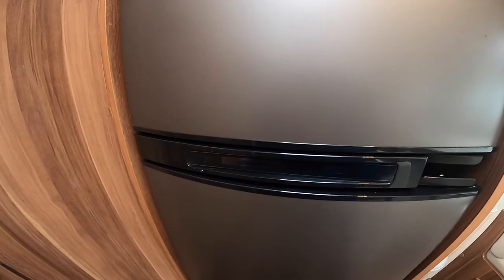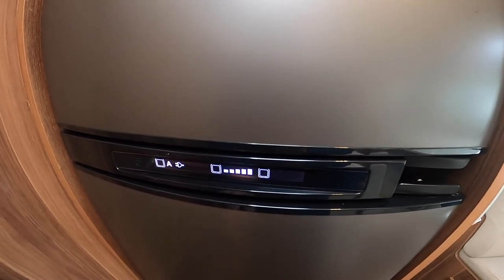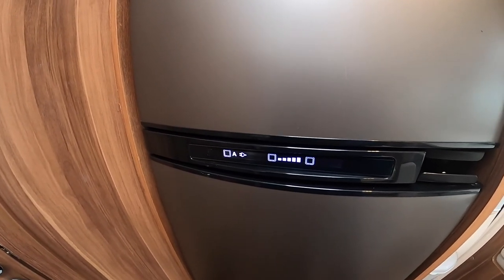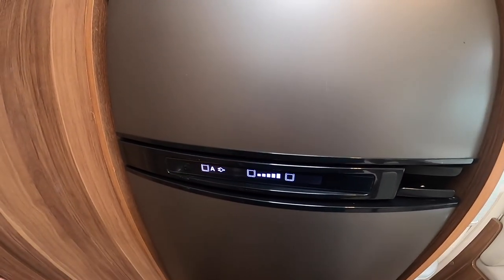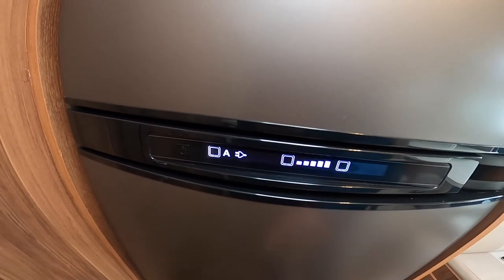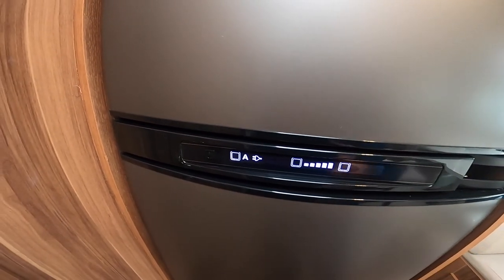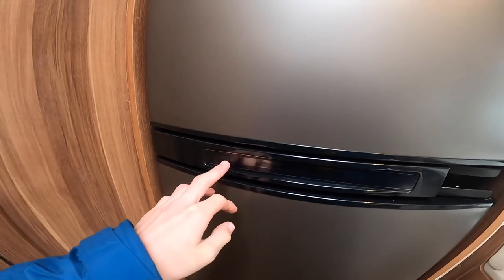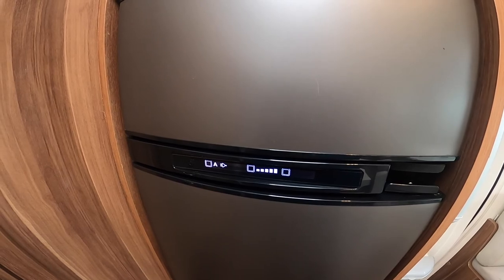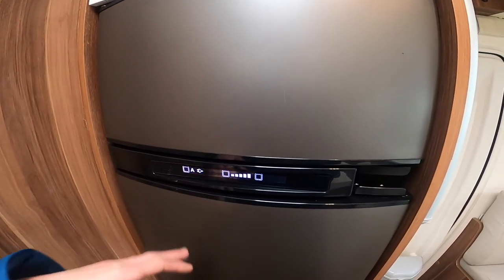If you're lucky enough to keep this at home, a few days before you go away you'll want to hook the vehicle up to charge your leisure battery, put your fridge on to full temperature, allow it to chill for a day or so, then put your shopping in the night before you go away and let your shopping cool overnight. Before you unhook it, just start the engine, unhook the vehicle, and it'll switch over to battery and keep that shopping nice and fresh until you either arrive back on site and hook the vehicle back up, or it will switch over to gas. Note that when turning the engine off, it waits 20 minutes before lighting on gas - because if you're pulling in for diesel, the last thing you want is it sparking. It's programmed to wait 20 minutes to get you out of any situations like that.